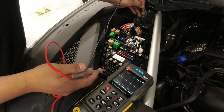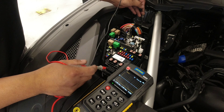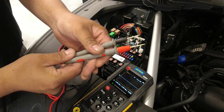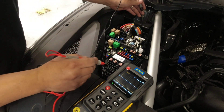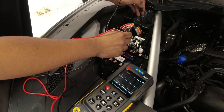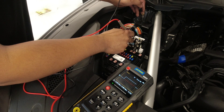For any electrical diagnosis, if you want to front-probe a connection just lightly touch. The correct way is to get the same terminal that goes into the connector, but we're just gonna do some quick checks. I'm just gonna lightly probe because the probe on this auto multimeter that comes with it is very thin — I think you can even pierce a wire with it, but we won't do that. I'll just lightly touch this. I think I need to do ignition on. With ignition on, I'll check my ground connection — it shows 12 volts.